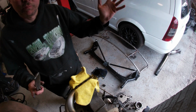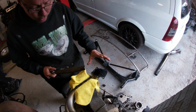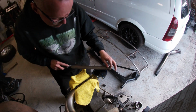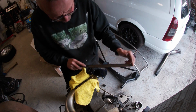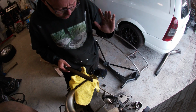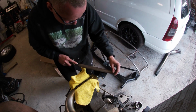So again, this is to highlight how much a flange will pull even when clamped to a heatsink block to keep it straight. Your file edge is obviously flat and true. When you file, it will show the high spot. The blue will come away and clean the area, and where it stays blue will be the low spots.